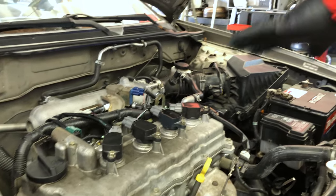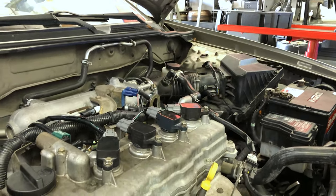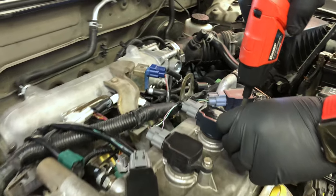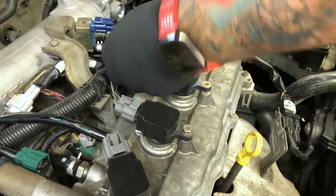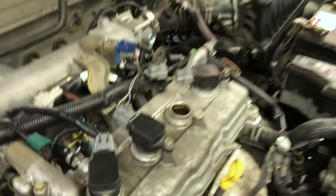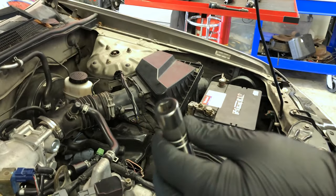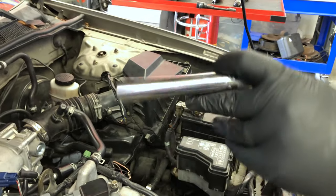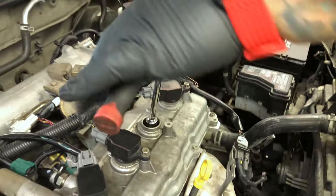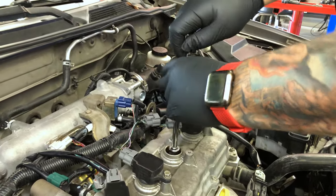One of the first steps is to remove our ignition coils. This car has four coils, one coil per cylinder. If your car doesn't have coils, you might have a distributor with spark plug wires — same process, you're just removing a spark plug wire instead of a coil. I'm going to go ahead and remove our ignition coil. It is acceptable to use power tools for this. Most common spark plugs use a 5/8 socket — I like a deep well socket, it works very well for cylinders that are deep like this one. So we'll go ahead and remove the spark plug.